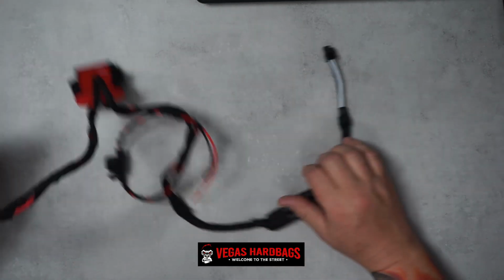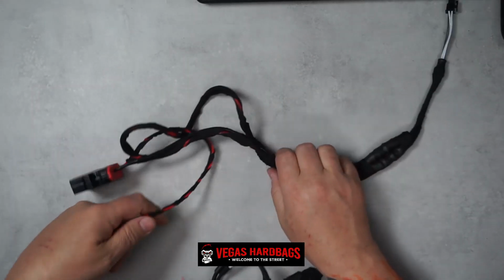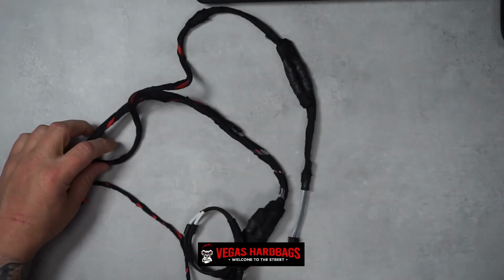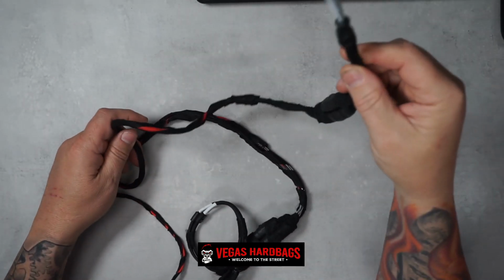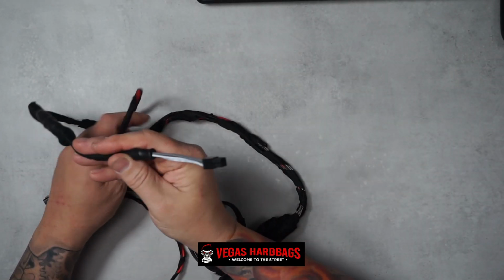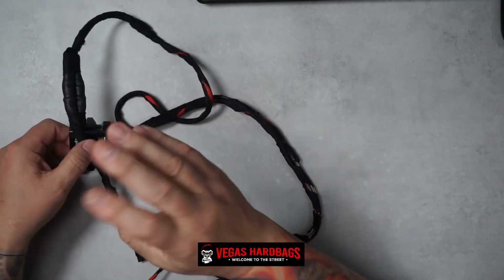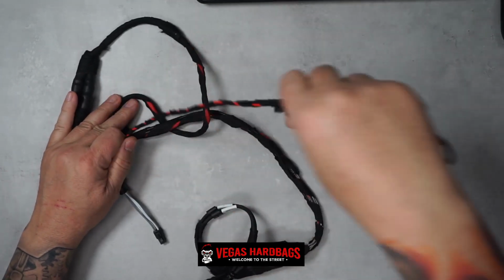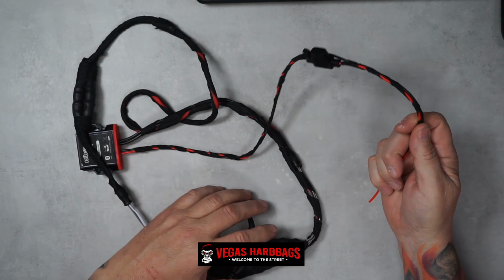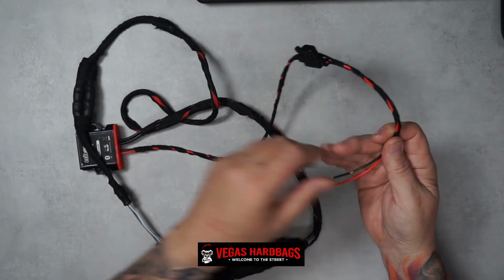The last set of cables that we have here is kind of cool. It's really kind of a 3-part. There's actually an upgraded version of this that will be shipping, just so you guys know. But this guy is going to plug in over here, and this is the signal to the amplifier from the Bluetooth controller. It's also got pairing instructions there. This cable goes up and over, and this is going to give me power, ground, and remote, which is going to go right to the amplifier, these connectors right there.